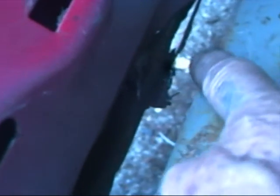Okay, there you go. I've cut out the worst of the rust, and what's left needs a bit of rust treating, and then grinding down ready. Once it's all done, the underneath welding will be done last. This will give me a better seal. All those holes there I can use to put wax oil down into the sills, so the rust isn't really a problem. As long as the rust stays dry, it won't rust anymore.